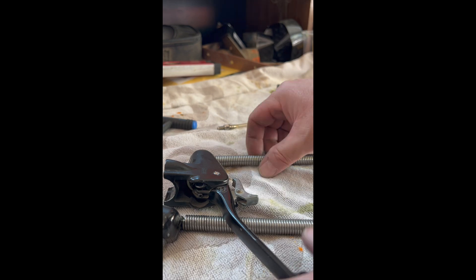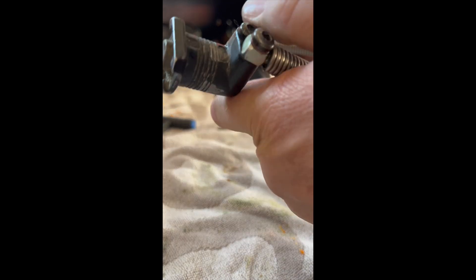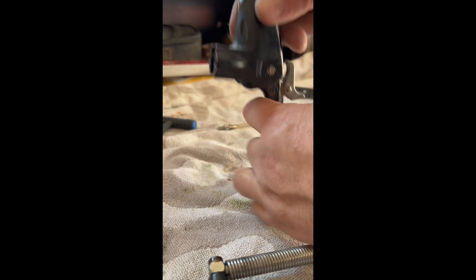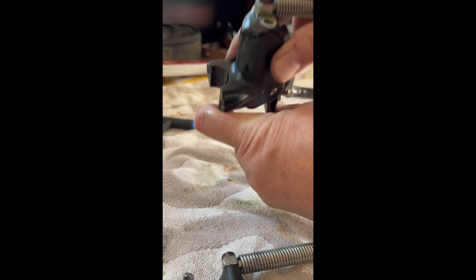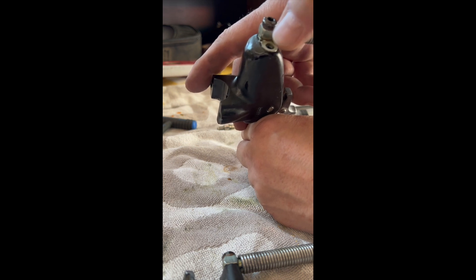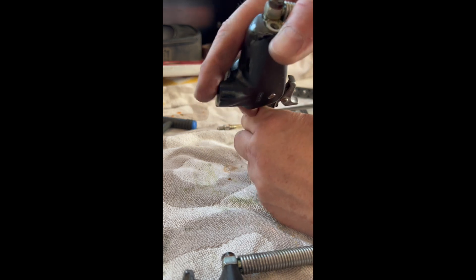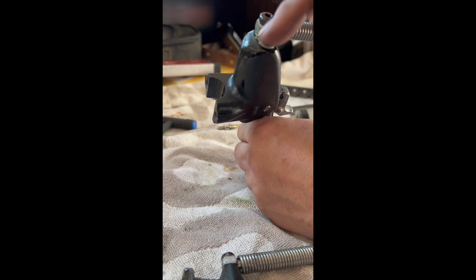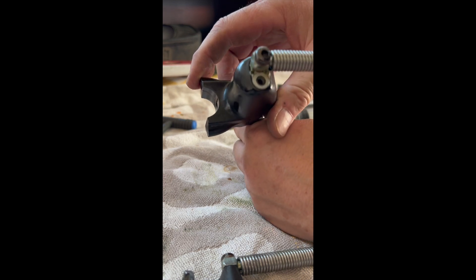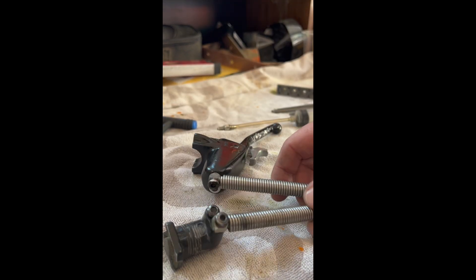It's very time consuming — it might take you 15 minutes or so. You're going to leave the slave cylinder screw in, take this screw out, and you're going to have to manually bleed the air out. If you pull on the lever with the screw out, air will slowly pop out. You'll have to manually pour a few drops in at a time, pull the lever, bleed the air out, then more drops, until you get the system functioning. Pain in the butt and time consuming, but you can get up and running that way. Hopefully that helps with recharging the clutch.